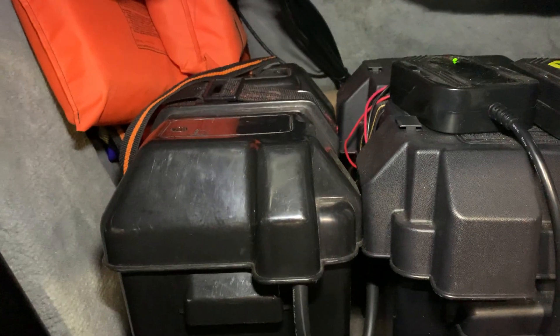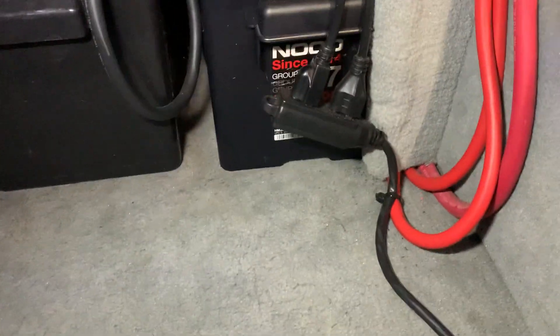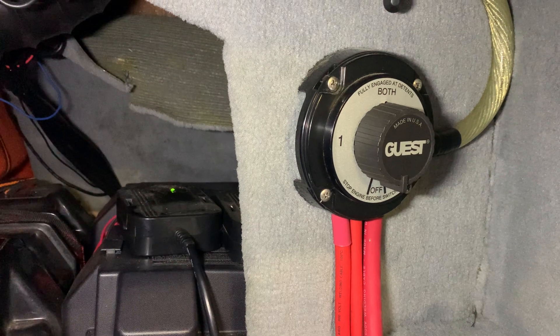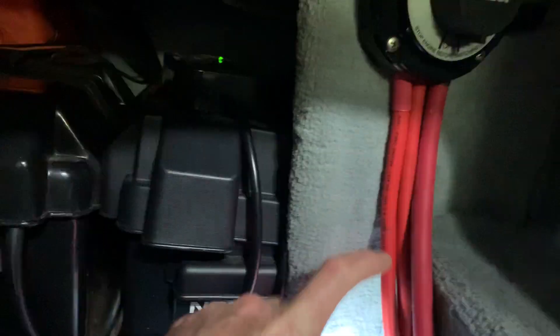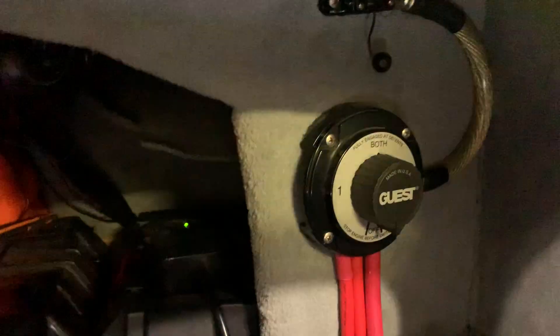The negative goes up and splits off to both batteries. The positive lines from the batteries simply run up to the switch. I didn't separate them — some guys run marine or engine on one and stereo on the other, but I have it all wired together. These are two-gauge wires coming from each battery positive up to the switch, and a slightly thicker gauge wire running back down underneath and through the compartment all the way back to the starter.